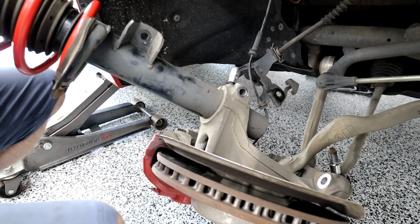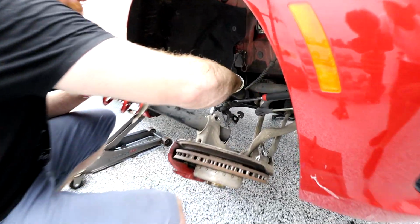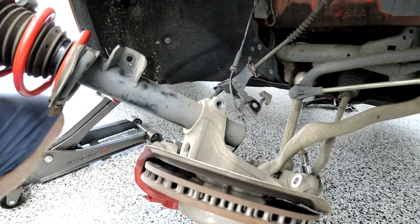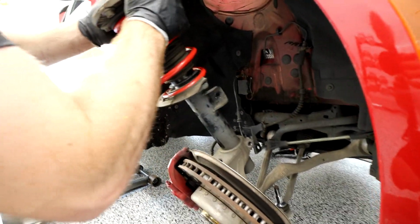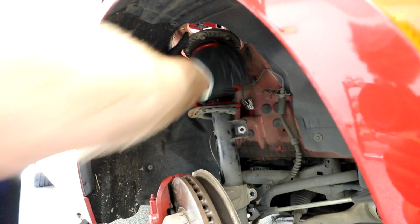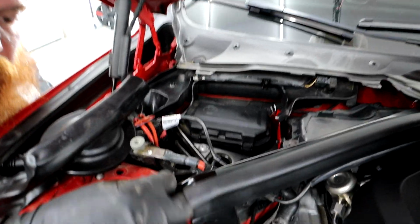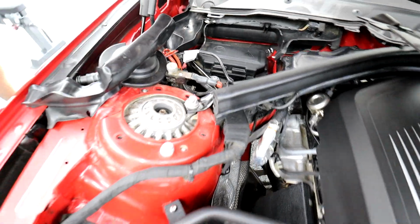We could actually release our knuckle spreader. It'll tighten it up into place. So when you release this, it'll just tighten right up. Alright guys, we got that taken care of. What we're going to do is press just a little bit to get clearance so we don't destroy his fender and come up. Now what we can do is push this up and catch a bolt. Sway bar. Start that guy up too. Have a couple in there.